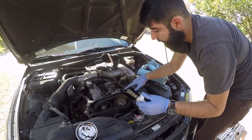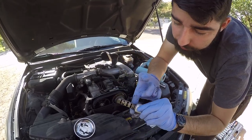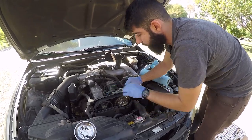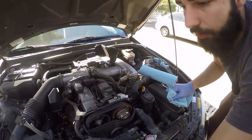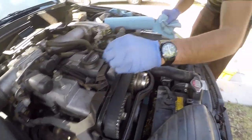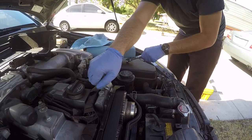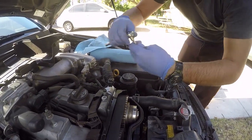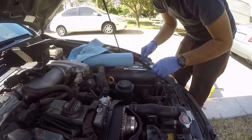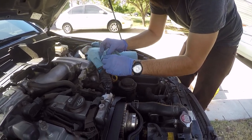The only thing you need to remember is there's a rubber seal in here — get some oil on your finger and lube up this rubber seal so it makes a nice connection and contact. Slides right in. Put your 10mm bolt back in here. It doesn't need to be too tight — my elbow would say that's about 17 foot-pounds of torque on that one.